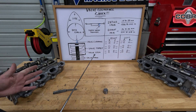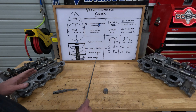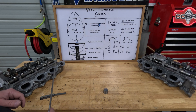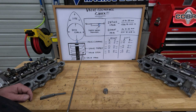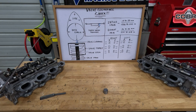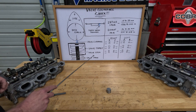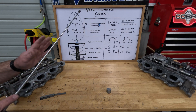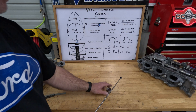The first thing you do when you get your heads off your engine — put them on the table, and you're going to get two egg cartons that hold 12 eggs each, and put them on the table next to the heads. You're going to label one right side, you're going to label the other left side. You're going to read top to bottom, left to right, and you're going to start taking the old tappets out of the heads and number them 1 through 12, accordingly.